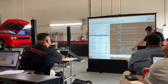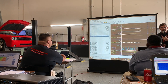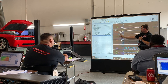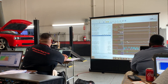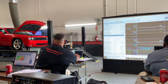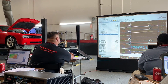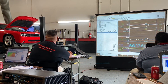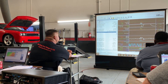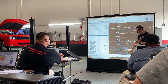What does this tell us about the fueling? It's fine. If it's oscillating, we're near stoich. Stoich is 14.7. Because it's in the tailpipe of the car, it's going to read the air - it's super low sometimes because it takes time for that air back there, and there's a lot of air around it, so the reading is diluted by fresh air. That's not uncommon, but we're not worried about that right now.